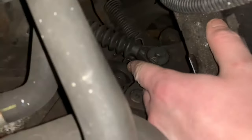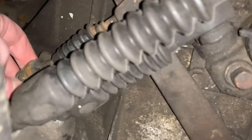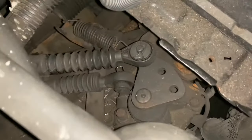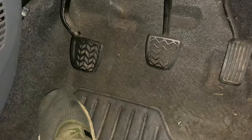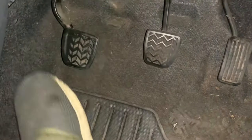Also, instead of adjusting the cable down here where we adjusted it, if you pull the cable up to the back here — I'll get it in shot — there's an adjuster for the outside of the cable. It does the same thing really. So now we've got it adjusted so it works properly. The pedal is a little bit high — not the biting point, the actual pedal. And there we have a little bit of free play and then a good sweep of clutch travel.